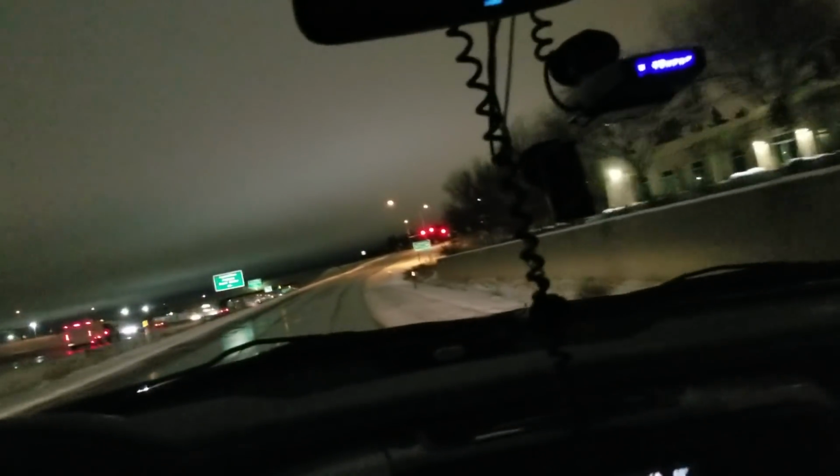Don't worry about it. But if you want to do a long run thing, if you want to squeeze the most miles out of that engine, make sure you warm them up. And I'll touch a little bit on that warmth. Guys, just because your engine's nice and toasty and you've idled it for an hour, in an extreme case, and everything's nice and warm, doesn't mean the rest of the components are warm. You get into that truck, take it easy for the first 5-10 minutes.